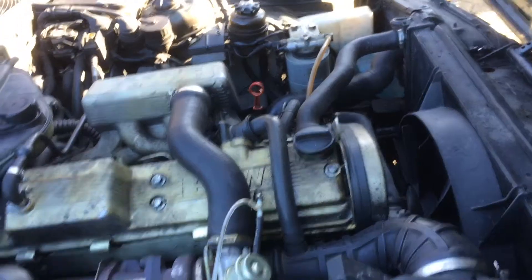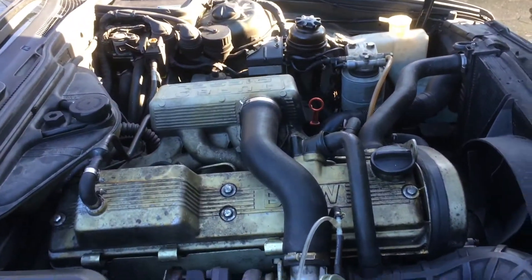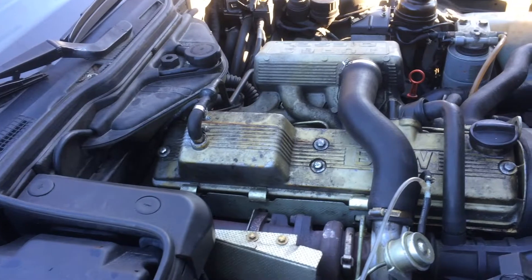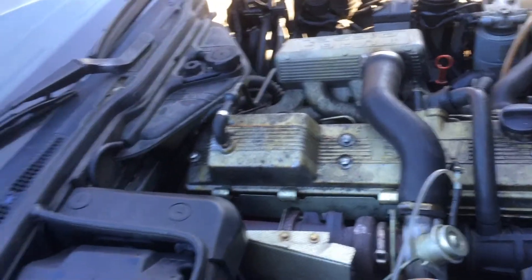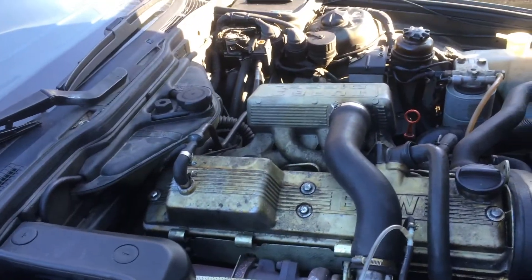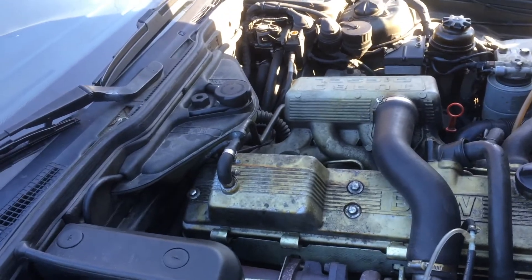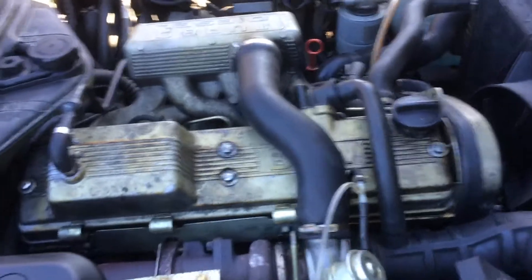It has some very loud clickety-clack noise from up top. I had the valve cover off quickly the other day and didn't find anything obvious. So today we're gonna pull it off again, check all the valve clearances, probably also take the vacuum pump off, which is for the brakes and stuff, and give it a quick run to see if it might be the vacuum pump doing the sound. Let's get into it — fairly straightforward job.